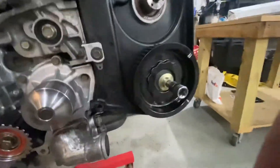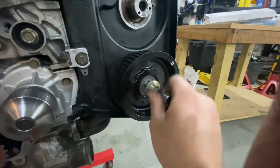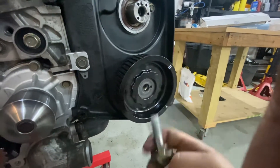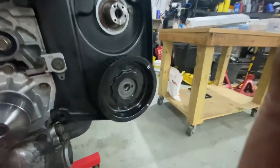Be very careful to keep the special wrench as flush as you possibly can. I have my feet under the engine so I don't want anything moving — I don't want this impact spinning this at all. If these weren't off recently and if I wasn't making a video I probably wouldn't do it that way. I feel like it's risky: if you slip off and the impact's going hard, you could just rotate this and might have some interference.